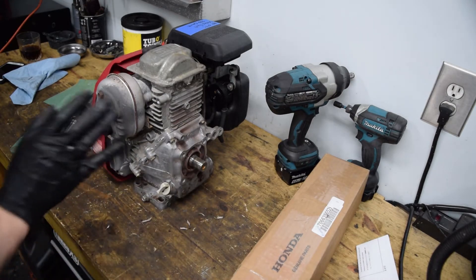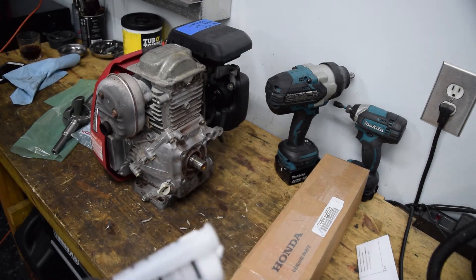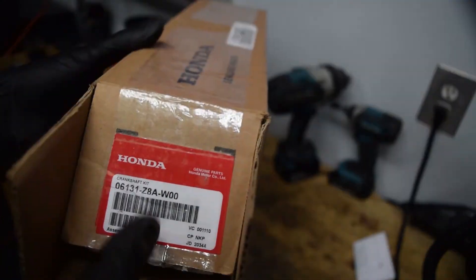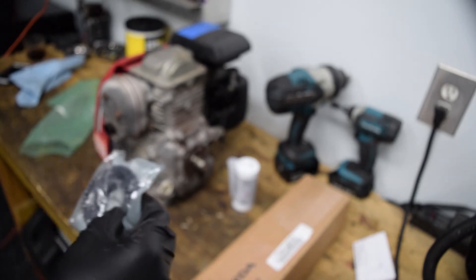You can see they're not neatly sealed from the factory — there's all sorts of excess here, so you don't have to worry about being super precise. But you do have to use a gasket material rated for heat and oil. The new crankshaft came with the little timing gear. This engine has a timing belt — just a tiny little cogged belt, like a vacuum cleaner belt.